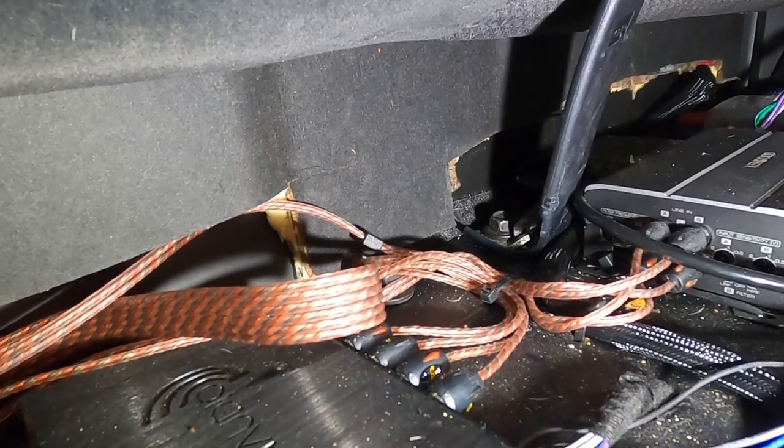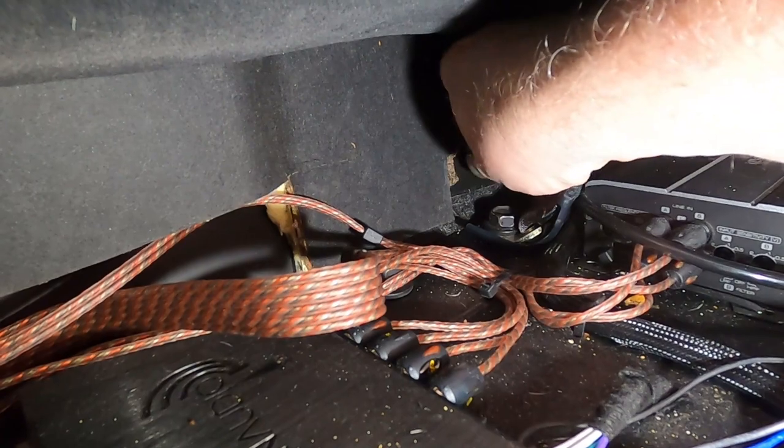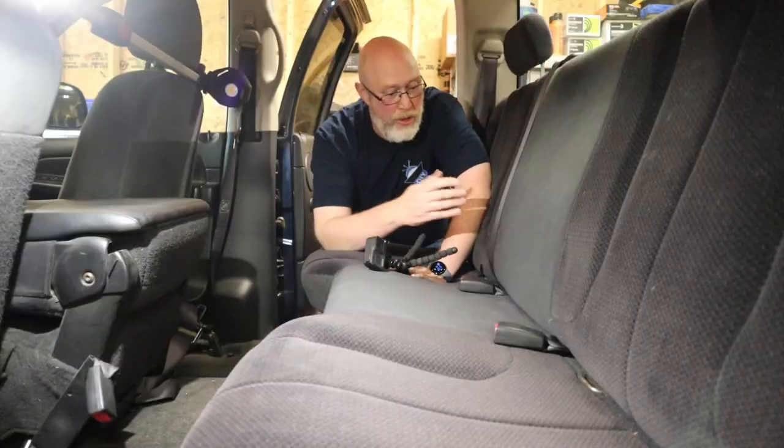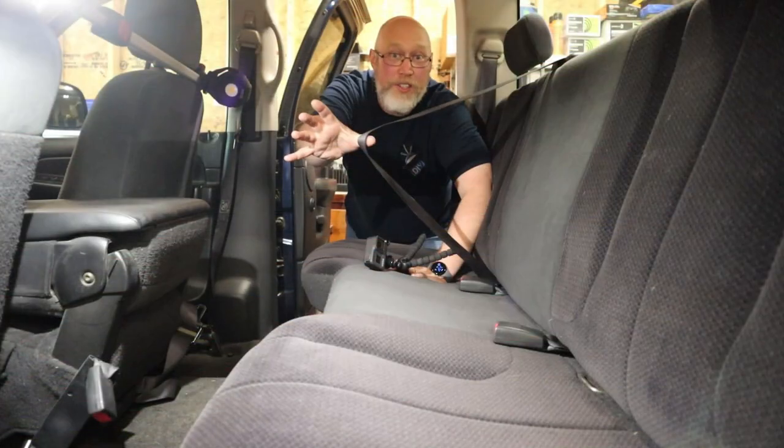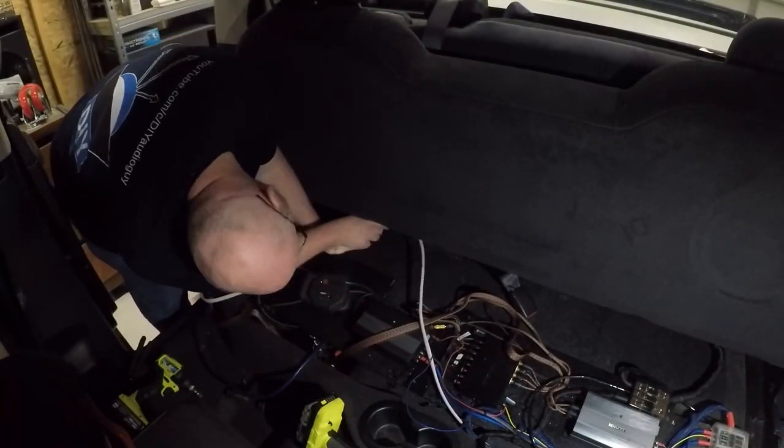What I've got to do now is remove the seat belts, which will allow me to slide the amp rack out, disconnect a few speaker wires, and then remove the seat belt mechanism for the center seat belt so I should be able to pull the seat out. When I built this amp rack it was my first attempt at clean wiring. I made one mistake that derailed everything — I ran the RCA and speaker wires from the front to the back. The right way to do it is to wire everything on a bench, install the amp rack, and then run all the wires from the amp rack in the back up to the front.